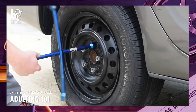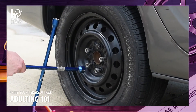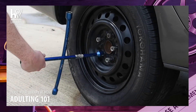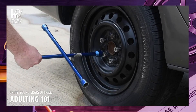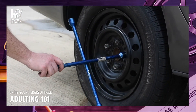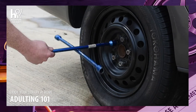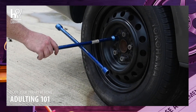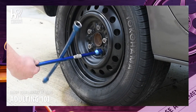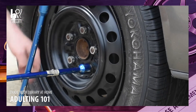I did have to lower the vehicle slightly so that the tire was in contact with the ground. This is a demonstration — this is not the final tightening of the lug nuts — but you'll notice I am getting them screwed on in a star pattern: starting from the top, to the bottom left, over to the right, and then back over to the left. And then back down to the bottom right. I'm going to screw this one on and apply pressure to tighten it, then repeat the star pattern.